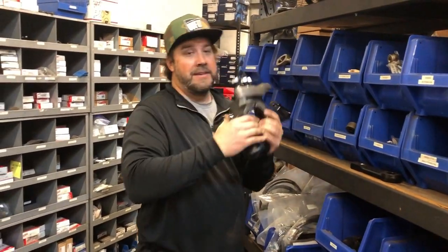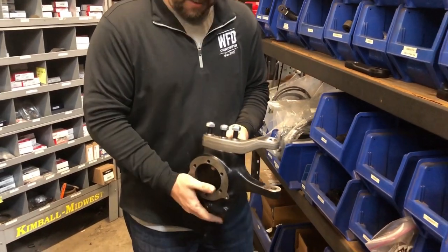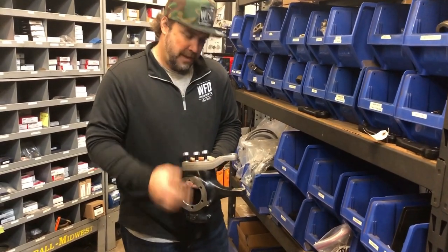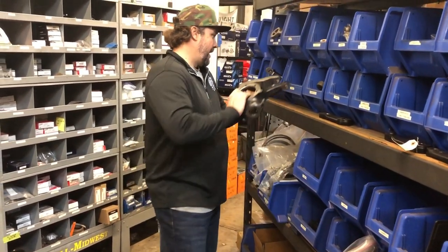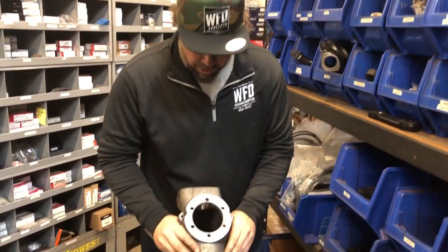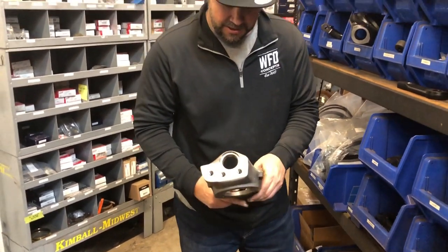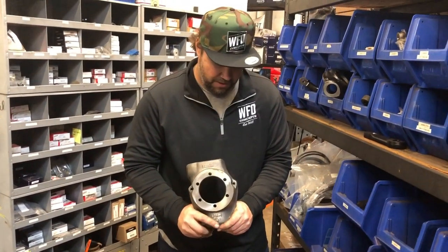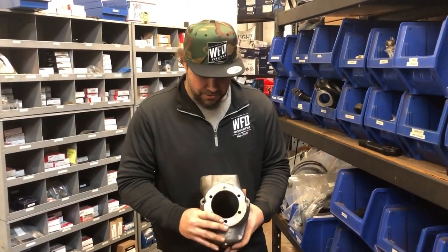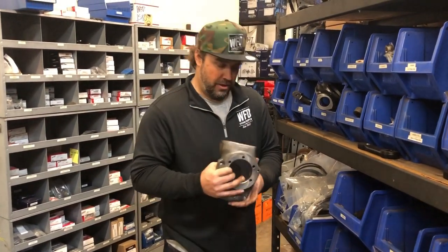Just to show what we're talking about - the reason you machine a knuckle is this: we have the crossover steering arm, stud kits, nut kits, cone kits. This is a right hand knuckle with the forged crossover steering arm set up and ready to go for Chevy drag link ends. If you're definitely going to full high steer, we also have the armless Dana 44 knuckles. These have the same flat top machined, still bolt-in replacement as far as brake spindles and all that. They have dual steering stops threaded into them but they don't have the factory arm sticking off. If you're going to run high steer, this is a nice option. We have pairs of these - you can check those out on the website.